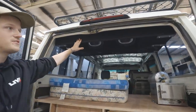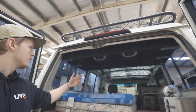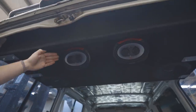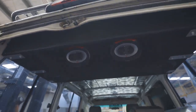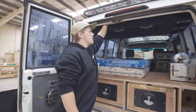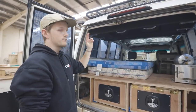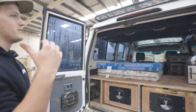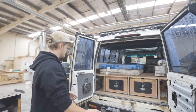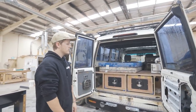This is just the fun bit of the Troopy — it's the party box. Built this with my dad at home. We've got two 10-inch subs on either side — 500-watt subs. Then we've got two 6x9s which are angled down so they shoot out the back of the car. It's a good area to utilise up in this roof because it goes quite high up there. The box is 270 thick, so there's a lot of room up there, and on the other side there's still plenty of headroom. That just shoots the sound out the back — so when you pull up to camp, you open up your doors and you've got a stereo shooting out the back of the car. I'm yet to sort out the door cards; I'm going to have fold-down tables and more speakers.